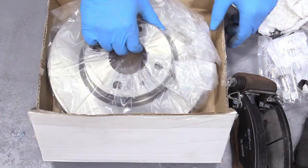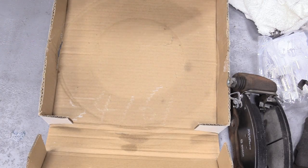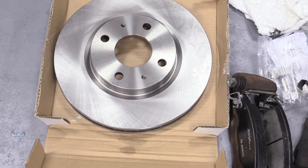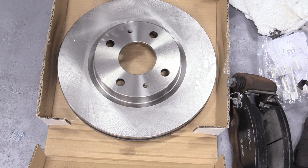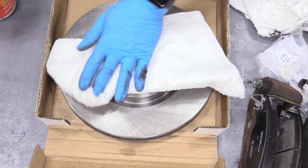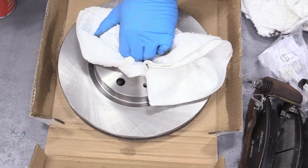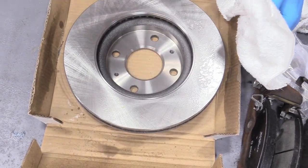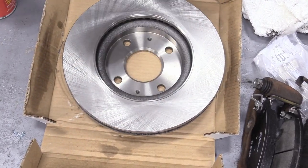Here are our rotors — they're an AC Delco unit. You can put AC Delco parts on a Ford; they make good parts for a good price, link in the description. When they make these rotors they have no idea how long they'll sit on the shelf, so they put a manufacturer's coating on them to prevent rust in transit. Nothing wrong with them if they sit that long — you just need to clean that off with brake cleaner or carburetor spray, because grease eliminates the whole point of having brakes. And there we go — this rotor is ready for the car.